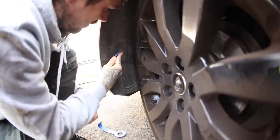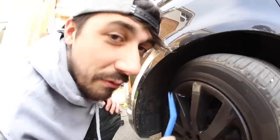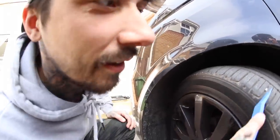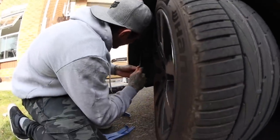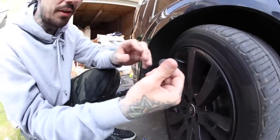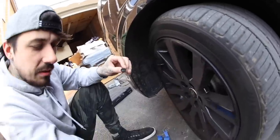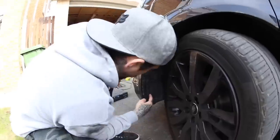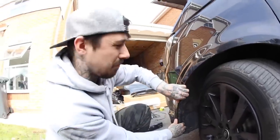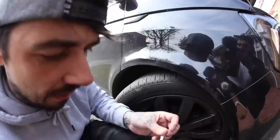Oh dear — the head just came off the tool, that's not good. 9.5J wide wheels will get in the way — if anybody's thinking of installing them and then working on the bumper, they will get in the way. With hard work and perseverance, the problem was the trim tool head snapped off and got stuck inside. We got it out anyway. Next is two bolts which release the bumper — T25 bolts on the outside of the bumper on the archway.